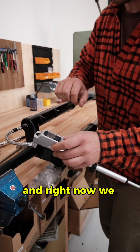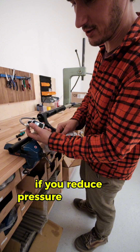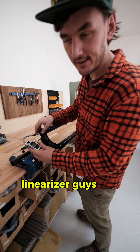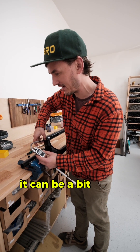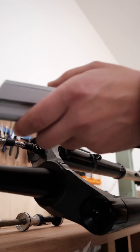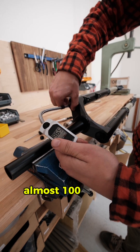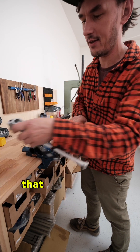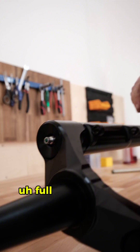We'll attach the shock pump — right now we have 78.5 psi, which works pretty good. If you reduce pressure to maybe 50 psi or less, some Travelizer users run a lot less pressure for the air spring, and with lower pressure it can be hard for the pin to come out. So I will raise the pressure to almost 100 psi — it's not always necessary, but it can help with a new fork or new air spring to get the green pin to come out more easily. Now you can see the green pin comes out full stroke, no problem.